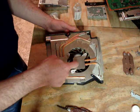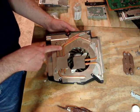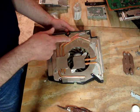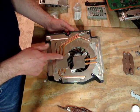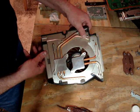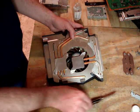Once the heat leaves the processors and travels through the heatsink paste into the block here, then it's carried away by these little veins, these little copper tubes. And they're ingenious little tubes. On the inside of these tubes, you've actually got a coolant, in a lot of cases a type of alcohol, and there's an awful lot of surface area on the inside of these tubes, and it acts like a miniature air conditioner. The alcohol comes in here just like the coolant in your car air conditioner. When the coolant contacts the heat, it evaporates and absorbs heat, and then it's wicked back out to the outer regions through capillary action, and then the fan blowing the heat away causes the alcohol, I believe that's what's inside these tubes, to condense again. So then the condensate comes back in, gets evaporated, drawn back out, condenses, just like your car or home air conditioner. It's the same process, just in miniature.